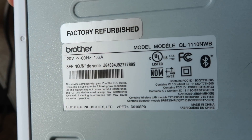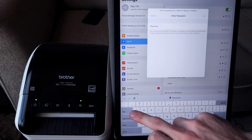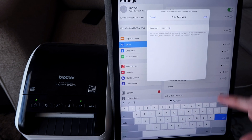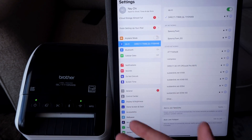As you can see, my serial number's last five digits are seven, seven, eight, nine, nine. Your last five are going to be different than mine. We're going to click on that network. The password is '111' and then the last five digits — so mine was seven, seven, eight, nine, nine. Hit join and it should connect directly to the printer. Hence why it's called Wi-Fi Direct.